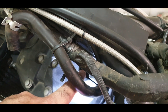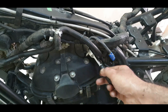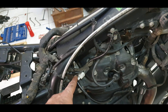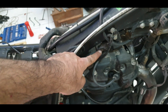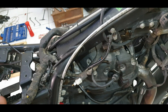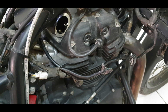The tank is already off. Next, we'll remove the tappet covers — 8mm here, 8mm on the other side, then 8mm here and 8mm on the other side as well. On the right side, when you see all these cables, it's helpful to move them out — press and pull back — then use a 10mm to loosen those. That's off.